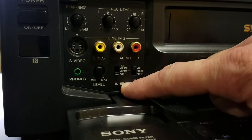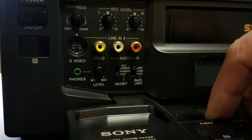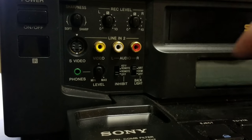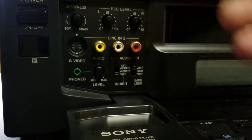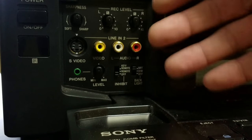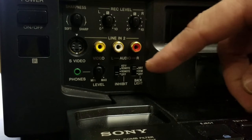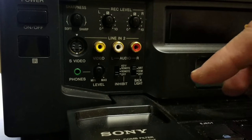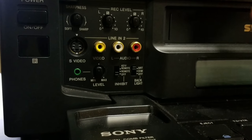There's also an inhibit button. What it does is — if you want to set this thing up displaying a videotape and leave it without anybody being able to make changes — you can activate one of the inhibit modes. You can turn it on with options: off, remote, or key and remote. If it's set to remote, it will not accept any remote signal. If it's on key and remote, you can't do anything at all to it — even accidentally hitting a button won't stop the VCR. So you could set it to record, and even if somebody hits a button, it will not affect the VCR at all. That's a pretty cool feature.